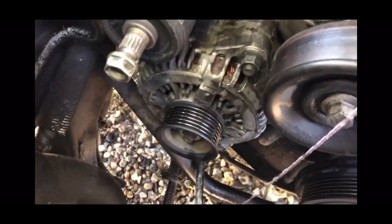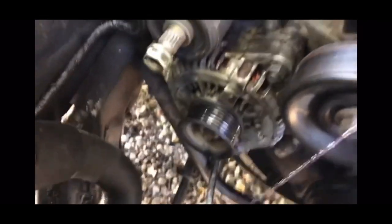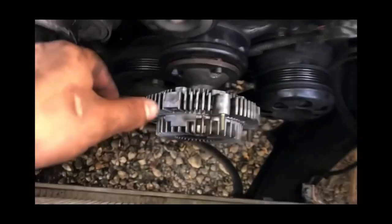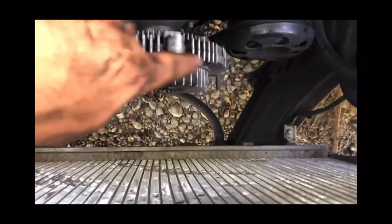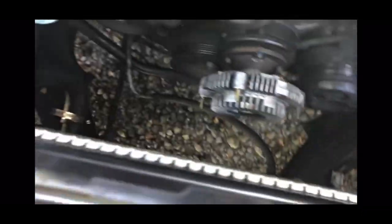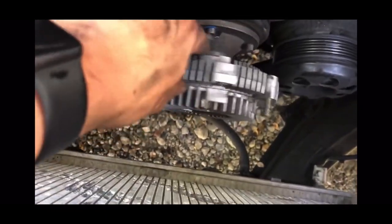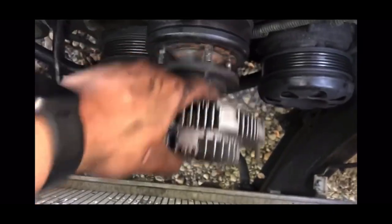Now I'm going to pull my alternator — I think these ones drop through the bottom of the car. If you are changing your tensioner assembly like I am, it's going to be four 12mm bolts. I think right here on the top is just two nuts, and right here are two actual bolts. For right here — this is where your fan should be, I don't run my fan. Pull the fan first, and your shroud if you have that. There will be four 12mm bolts right here — with an open-end wrench, this will slide right off.